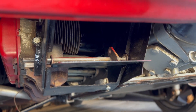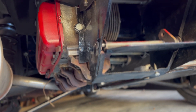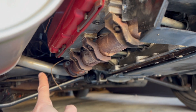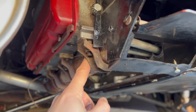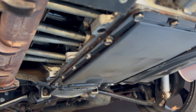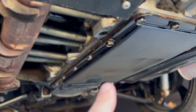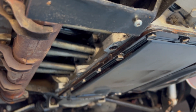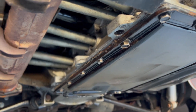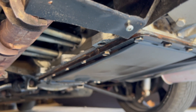I'll show you this while I've got this cover off. There's one of your cylinder heads and here's your head. This is the exhaust coming out here, comes right to the muffler. It's like a motorcycle — think of a Harley. There are your push rod tubes; they ride on the cam and push the lifters, just like a small block Chevy. But these things are only sealed with O-rings, so they're prone to oil leaks because the O-rings will start to seep oil.